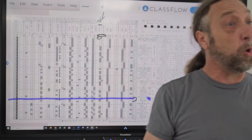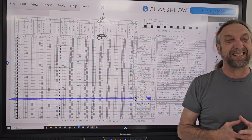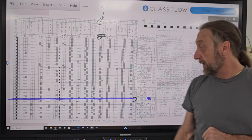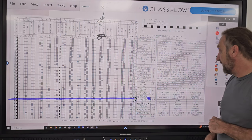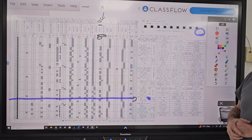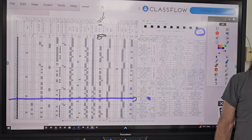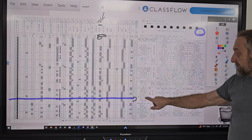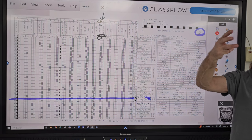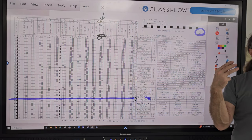Well, this is some of the older ones. Some of the newer ones I don't know now, but the older machines used to pump up to 17 gallons per minute. Okay? Well, each one of these increments, this one I think says 171 seconds long. That's almost a 3 minute cycle, right? So when it agitates low, it's only one increment, but it's going to agitate for 3 minutes. But when we drain on high, we're going to drain for 3 minutes.